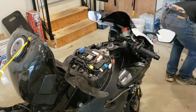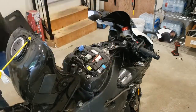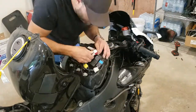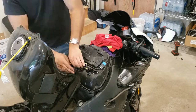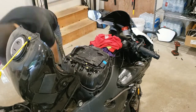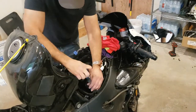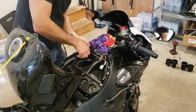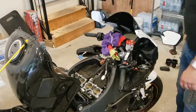I'm going to unplug all these connectors, and then there are several screws holding the air box on — we're going to remove those. The top part of the air box and these little downdraft tunnels are going to come off, then the bottom of the air box, and lastly we're going to unbolt and remove the ram air ducts.